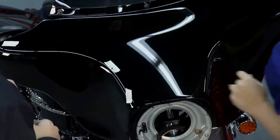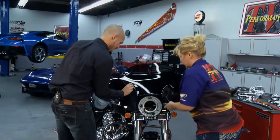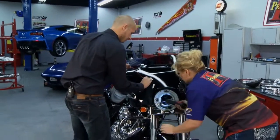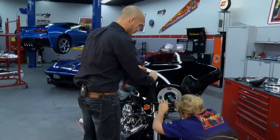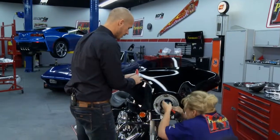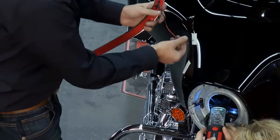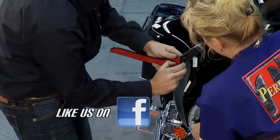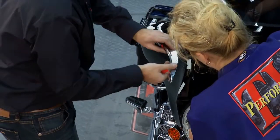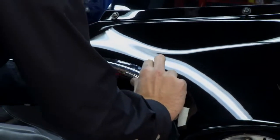Now we're ready to drill. We're going to feed that through there. What we do is we clean and prep the surface, and then on the back side we're just going to activate the catalyst and the adhesive — just rub it with the back of your fingernail to get it ready to go. We'll feed that wire down and just stick it on, starting with this first piece, peel a little bit of it up, get it stuck, and then finish it off. Pull your wire through a little bit, line it up with our tape, and then just work your way right down.